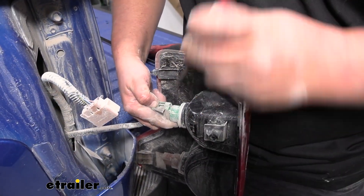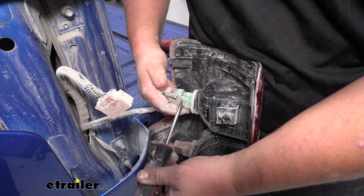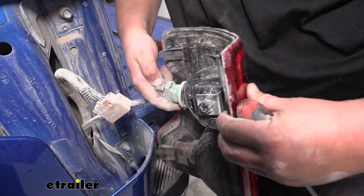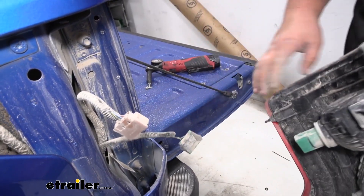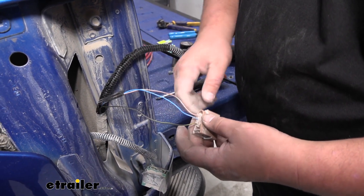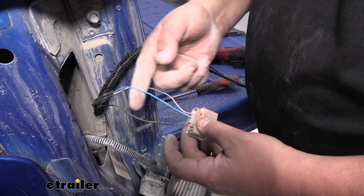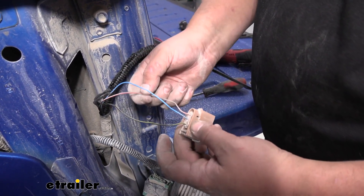If you're having trouble getting the connector off, you can take a flat blade screwdriver and follow the line on the sides to pry the connector off. Be careful not to drop your tail light assembly. Once removed, we can set our tail light assembly in the bed. With all of our covering stripped back, we have our wires exposed. Our center pin — the blue wire with a gray stripe — is going to be our tail light signal, and our orange wire with a gray stripe is going to be our brake and turn signal.